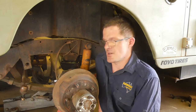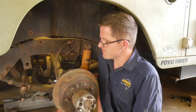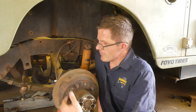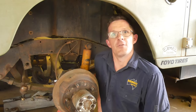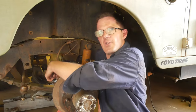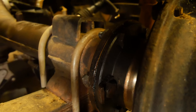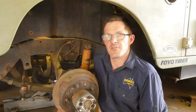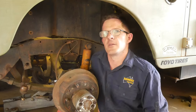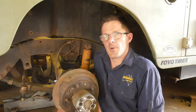When they do start spinning, that's usually a good time to replace them because obviously something has gone amiss inside. Once we've done that, we have a number of bolts or nuts to undo around the flange of the swivel hub housing itself. You want to make sure you leave the top bolt in the flange just to take the overall weight of the swivel hub.